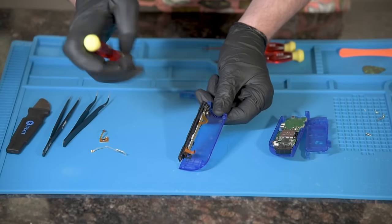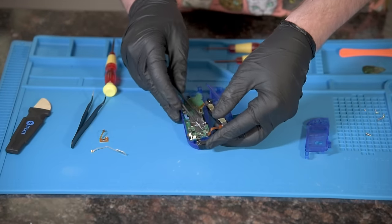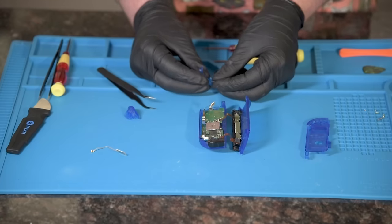Next step is to connect the ribbon cable to the logic board. It'll make the rest of the assembly easier. Again, remember the input latches. Pick up your trigger button cable and place it in the input. To finish this layer, locate the bumper button and the long spring.